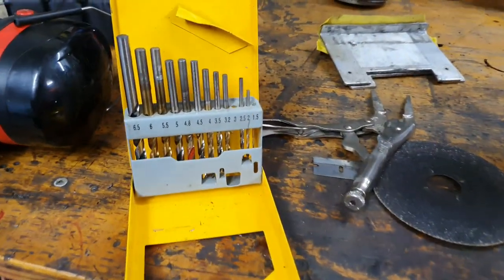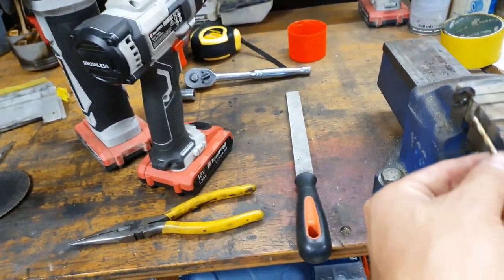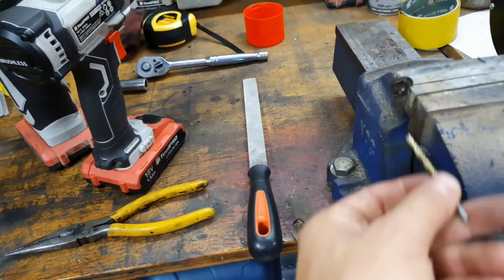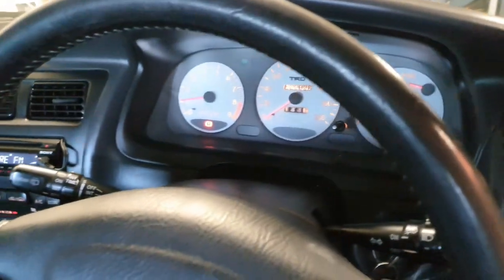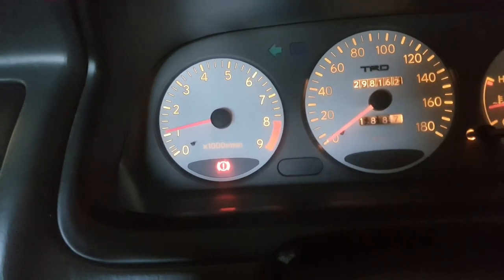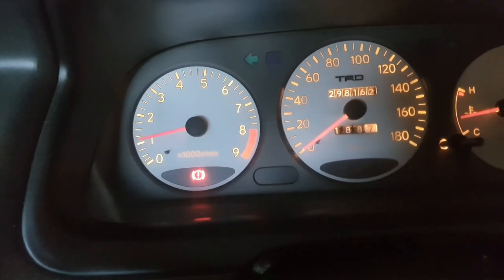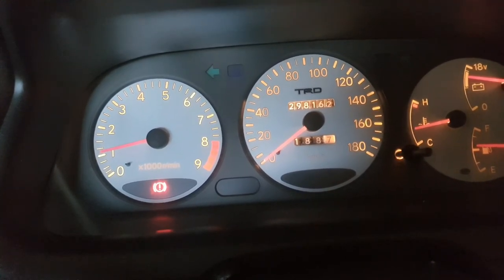Before I drilled a 2mm hole - this time I'm going to try a 3mm hole, and if that doesn't work I'll go up another size. I drilled it one more millimeter bigger and the revs have come up that much more. I think I might actually leave it there and see how we get on. Drive it over the next few weeks, and if it needs to be altered I might have to go for 2.5mm - that might be the ideal size.